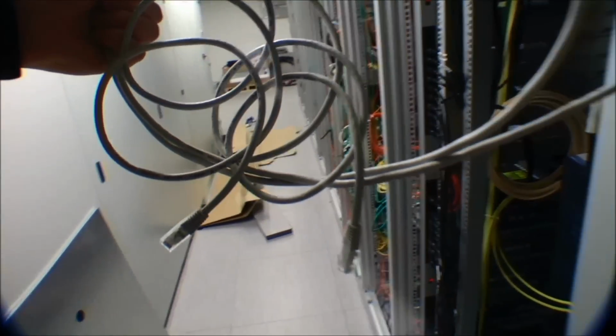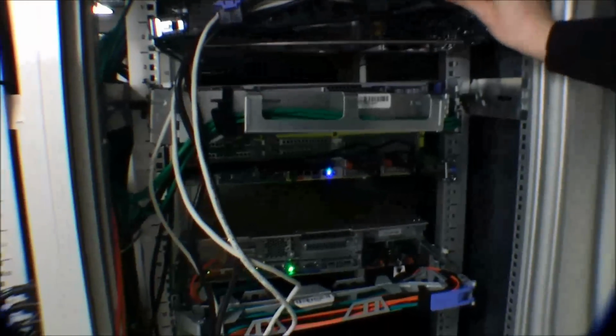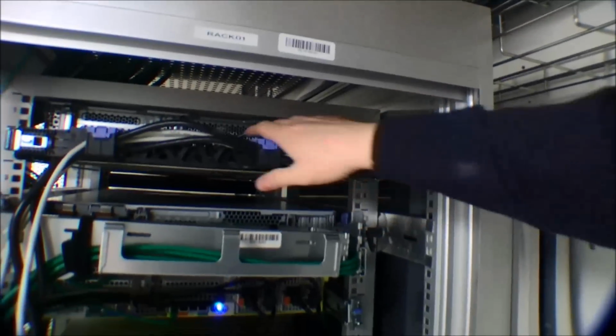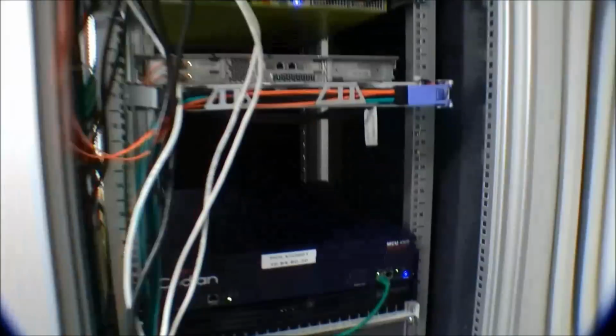it's really no problem to see which goes where, but when everything is up in the cable arm, it gets kind of hard to follow the cables in the arm, and I need this when I plug it into the switch, because I have to configure the ports of the switch. We have VLANs for the network connections, and we have another VLAN for the management adapters, and we have this redundancy so that, oh yeah, we have that on power too.